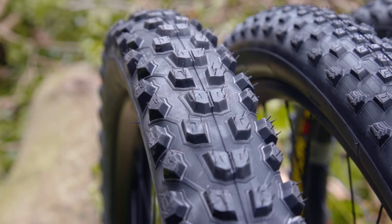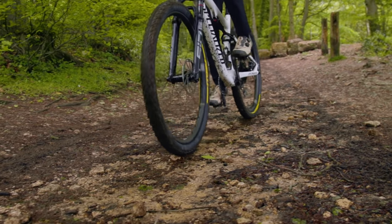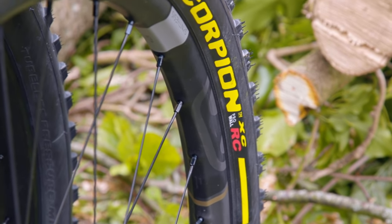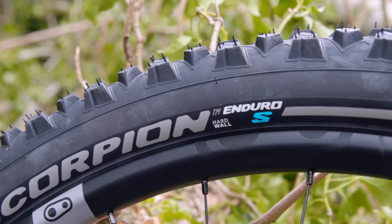Going a bit deeper, wider tyres tend to perform better on wider rims. A wide tyre on a narrow rim can be more light bulb-shaped once inflated and prone to rolling side-to-side, leading to an imprecise feel. A narrow tyre on a wide rim becomes too square, which changes the feel as you lean into a corner and can lead to the shoulder tread squirming with cornering lean angles being reduced. A narrower 2.2-inch tyre might be better on a rim with an internal width of roughly 25mm. A 2.4-inch tyre on a 25-30mm rim is a good starting point. At 2.5 or 2.6 inches wide, we'd be looking for a 28-33mm rim, and 2.8-inch tyres are likely best suited to a 35mm-plus rim.